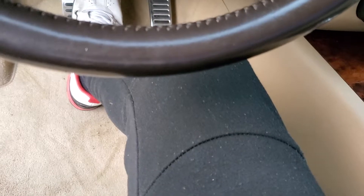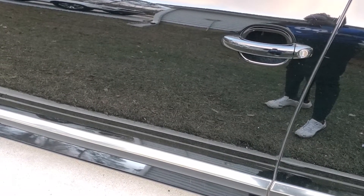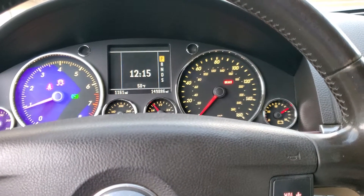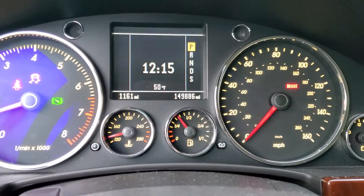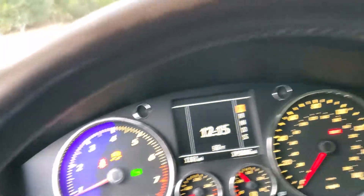Let me grab the key so I can turn it on and make sure everything is working. I think I might have to — hope I didn't kill it already. Okay, I just have to try this again. Maybe I just had to do a reset like that. There it goes. So if you change the battery, you do have to close the door, lock it, and then turn it back on again in order for your car to reset. That scared me for a second, but that was live action. So now it's reset. Of course you have all these warning lights on — once you start to drive, all those warning lights will go off.